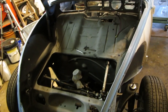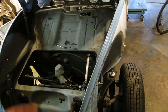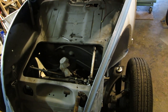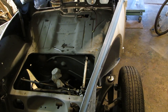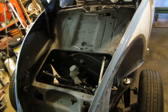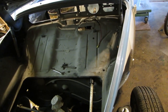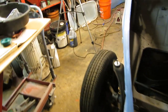You can go into a glass shop and get yourself 3 or 4 tubes, and they have a continual supply. Cut the very end of it off, and there'll be about 4 tablespoons of urethane there. Of course, you can't gun it, but you could put it in a bag and squeeze it, and it would work, cutting a hole in it like frosting a cake. But it's free, and it's always fresh if you're trying to pinch pennies. So that's something to think about.